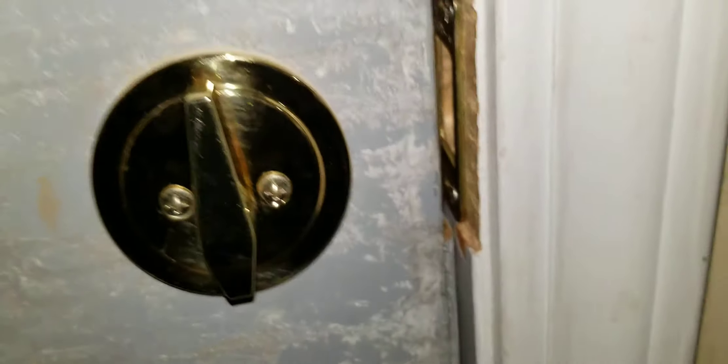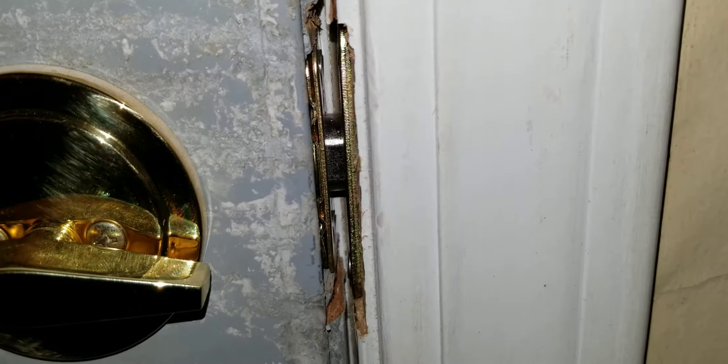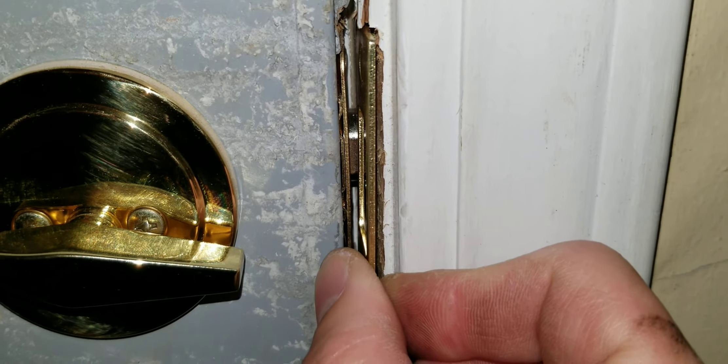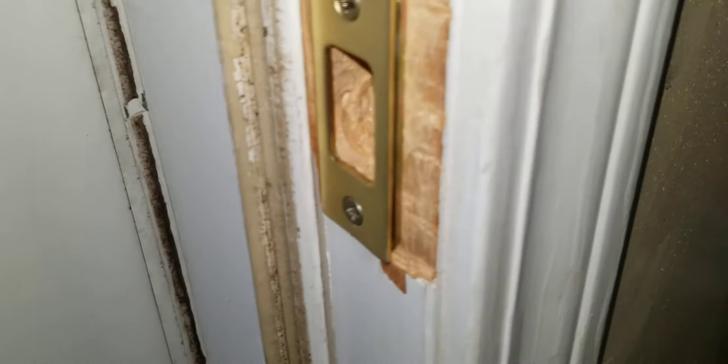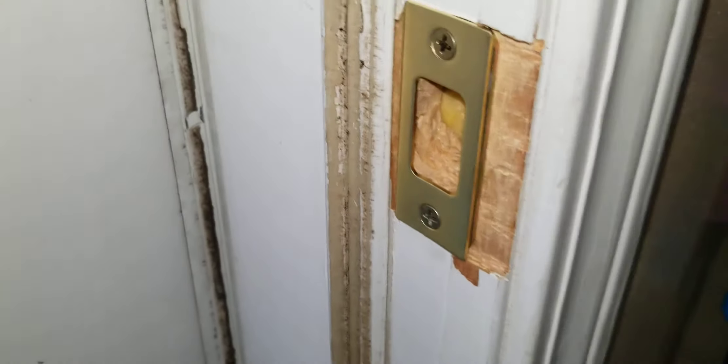There's only a small gap there — I had to cut a little bit off the door to make everything fit, but it closes perfectly. This filler piece will take up the space. We'll get it all installed and take a look at it. Alright, the striker plate's installed — you can see the double plate there for security. You just got to get some wood filler and fill this in if you had to make some adjustments or chips. Close it up and that's that.